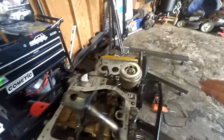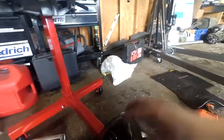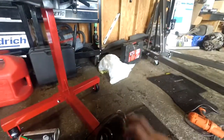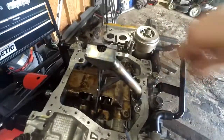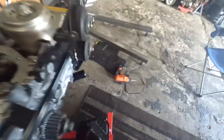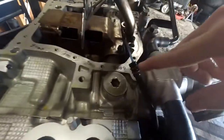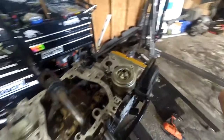So if I want to use it I've got to have a matching oil pan, and if you want to have the matching oil pan you've got to have the matching dipstick too - which I went over all that in the last video. So I'm just going to make sure all these bolts are tight, clean up the surface, and then I can put some silicone RTV on there and get this pan on for the final time. I also got some new O-rings for the dipstick tube, so I need to make sure everything is clean before I do this.